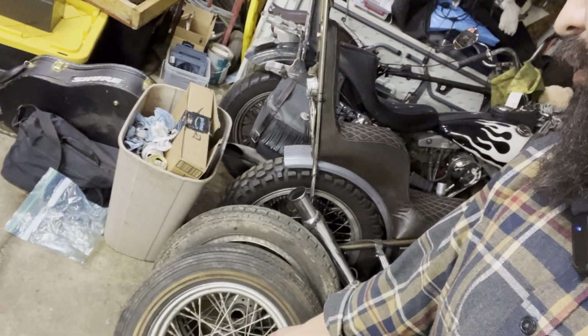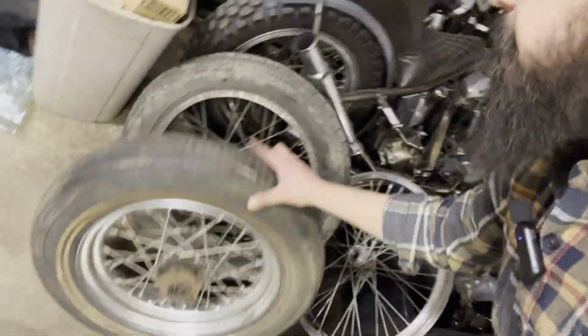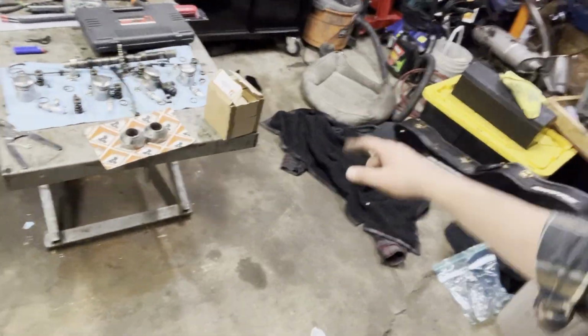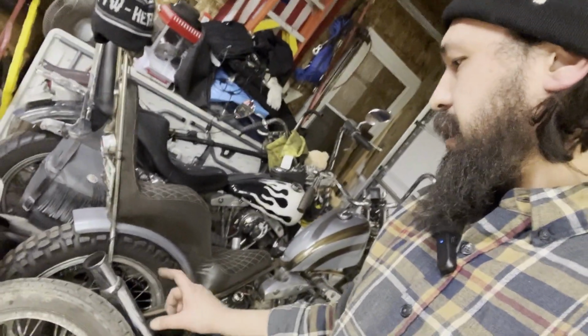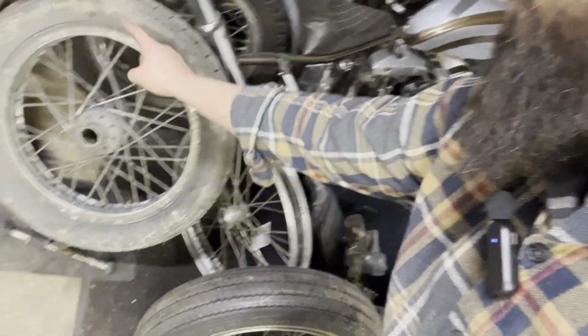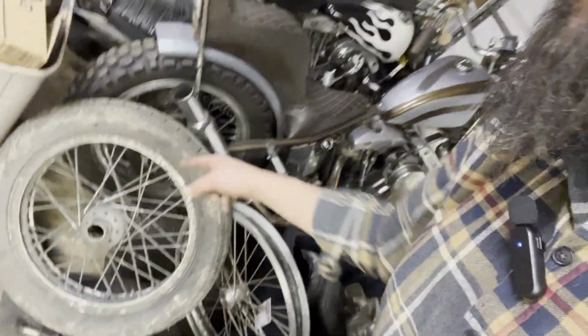Then we have the OG dual flange wheel, but I need some of the guts from that. I do have a brand new, that box right there is the brand new bearings for this wheel. Bearings, races, the whole deal, except for the spacer part. I don't know how well that's going to work on this, but I am going to run this high shoulder. I know it's super crusty, but this is all aluminum. This will clean up. I got the new rear tire ordered because I'm going to need that to mock up